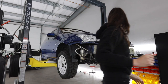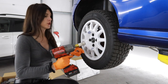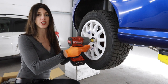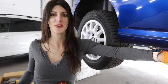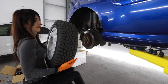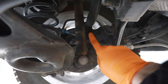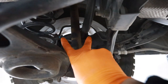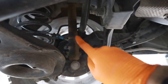Because these coilovers were custom made for this car and it's not just a factory spec Focus, there's no guarantee these are going to fit first attempt. Hopefully I took enough measurements, but there's a slight possibility they might not — let's be optimistic though. Just by eyeballing it underneath here, the one thing that makes me a little nervous is how close the strut body comes to this upper control arm, because I have to fit a coilover up inside there. I'm ditching the spring-in-a-bucket setup and just going for a coilover on strut.